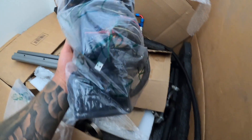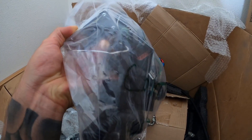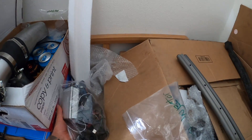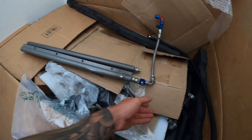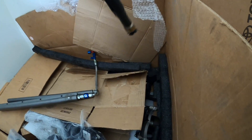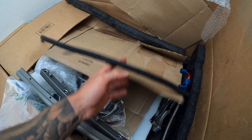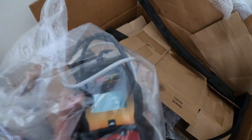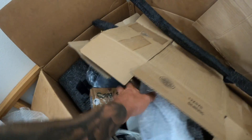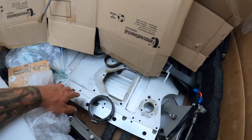We're going to be flashing the car with HP Tuners so I won't need the piggyback controller, but I have the full unit — the Viper guys were using this for years so it's effective if somebody wants it. There's a tensioner, the belt, a long fuel line that converts back to the factory fitting, and an SCT that also came with the ROW kit. I have two engine management systems I won't be needing.